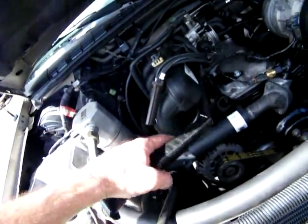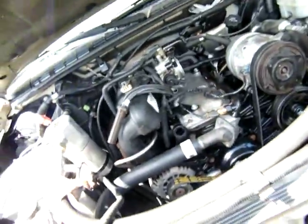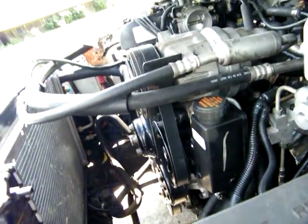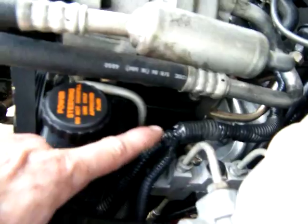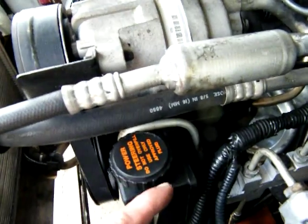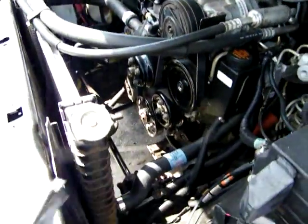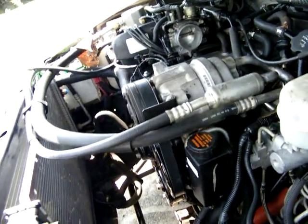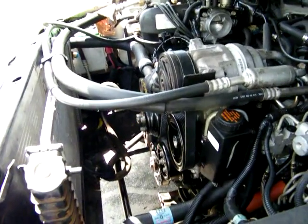It's got power on it — that's where the plug went. I had to take the alternator off, pull that thing out back there, plug it in, put it back on, then put the alternator back on. And I'll tell you something — this power steering pump is a job. Do not put the pulley on first. Put that bracket on in the back first, then put your power steering pump on, get those two back bolts into the bracket and into the head. The pulley is the last thing you put on.